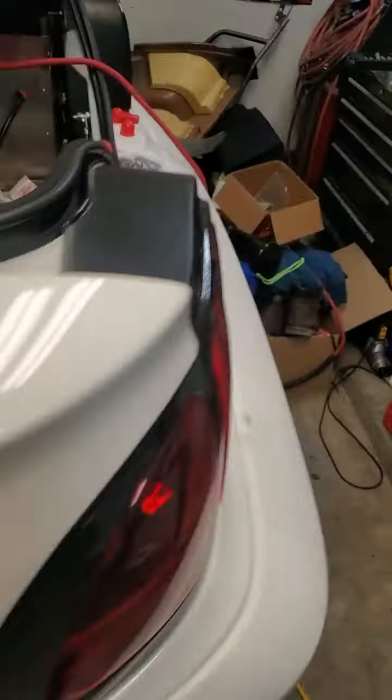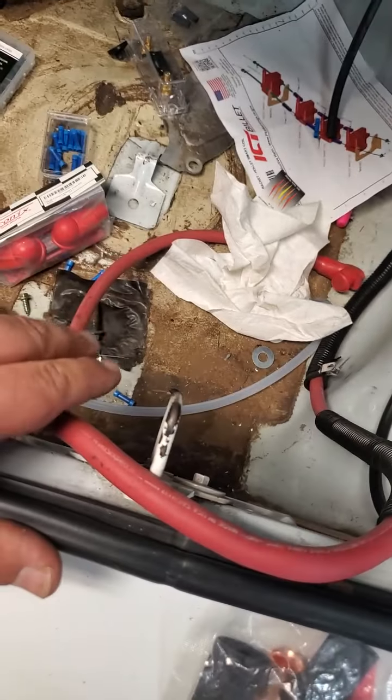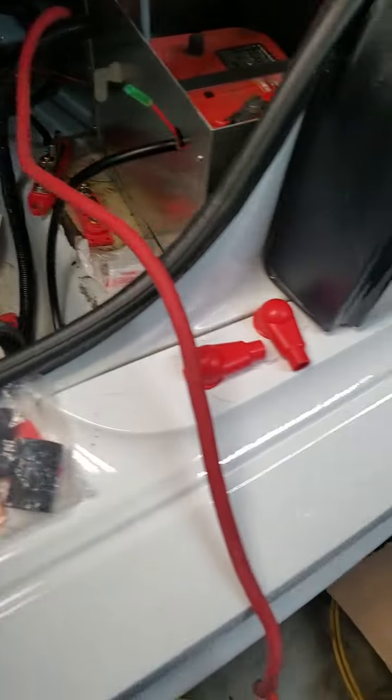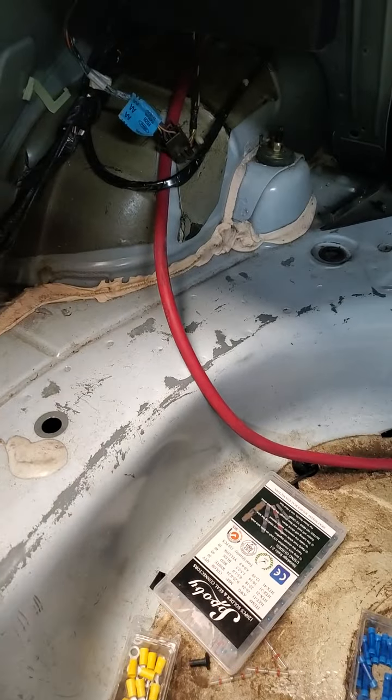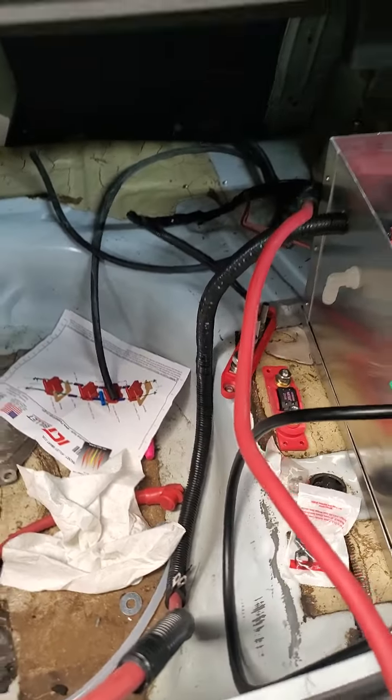I have a Low Dollar oil pressure sensor tied into that brass fitting back here. Like I said, I started running my battery lines to the back - battery's mounted back there. Running the Holley stuff, the relay for the fuel pump was on here last time. Was waiting on some crimpers - they finally came but Amazon sent me the book instead of the actual crimpers, so that was an interesting find on my doorstep. That line is going to run over the fuse box, I'm going to put a breaker in here and tie it to the on/off switch - haven't figured out exactly how I'm doing that yet.